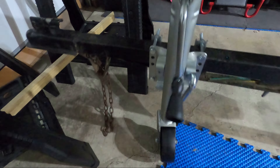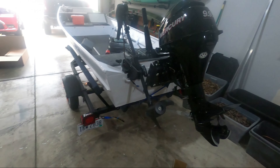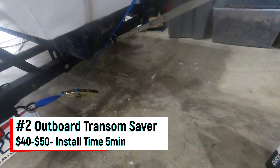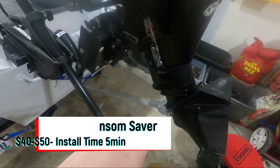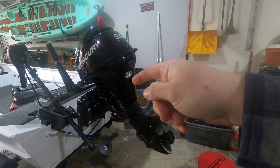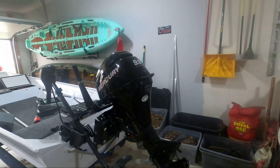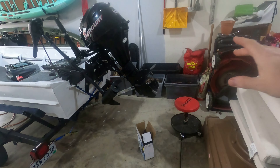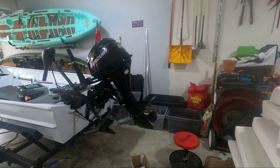We'll be able to move this around a lot easier and lower it down when we need to. Now this next item is not necessarily an upgrade for your trailer, but it attaches to your trailer, so I'm going to include it — and that is a transom saver. Transom savers attach to a point on your trailer towards the bottom and run a brace to the bottom of your outboard. When you're driving and hit a bump, rather than your outboard bouncing up and smashing back down onto its bracket, this keeps the force interconnected with your trailer to brace the impacts. I live on a very steep driveway, so without the transom saver I was hitting the skeg using just the bracket to keep the motor up.